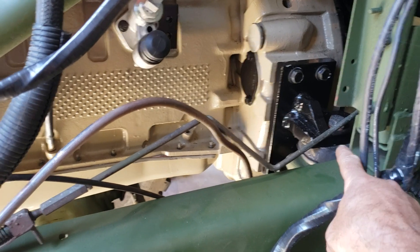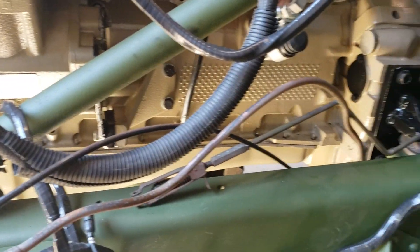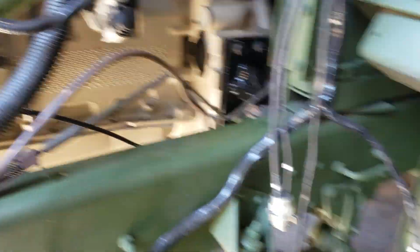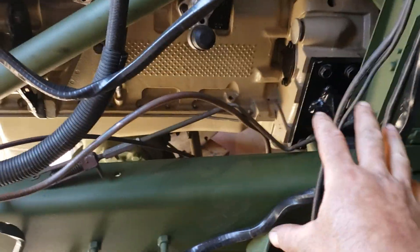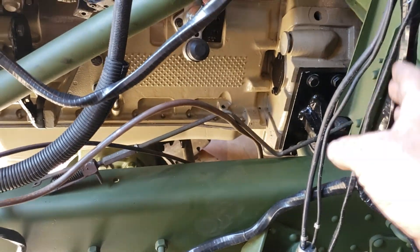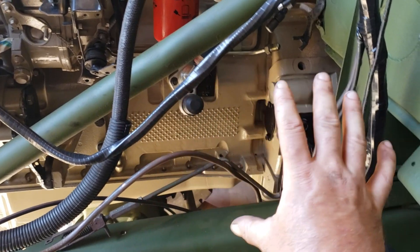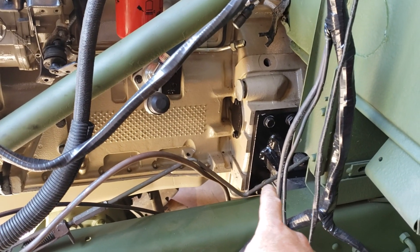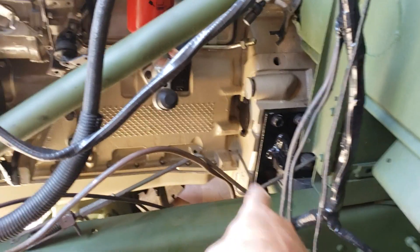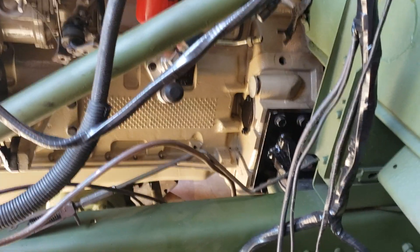As you know, the throttle linkage originally for the multi-fuel comes straight out because the pump is down here by the steering box. I've already made a couple of bends in it. I'm not going to give you the measurements for that because I just laid it out by eyeball. And where you put your motor in the truck is going to make a huge difference — even 7/16ths or half an inch forward or back will make a big difference in where your bends need to be, so that you're going to have to figure out on your own.